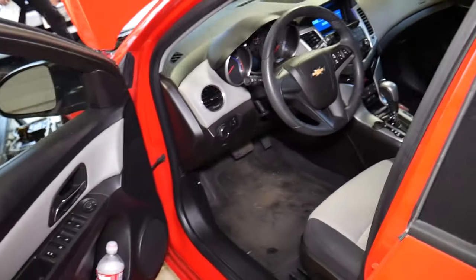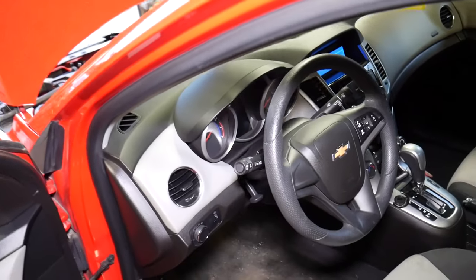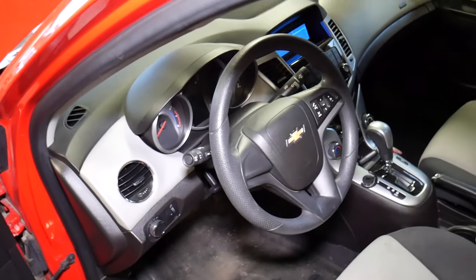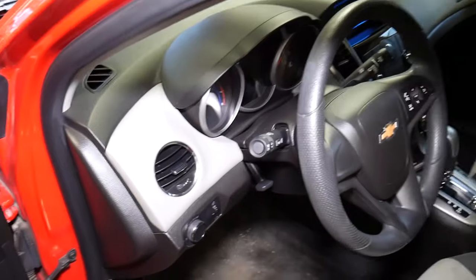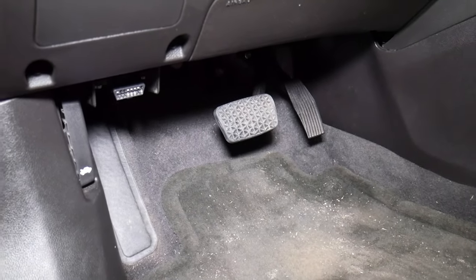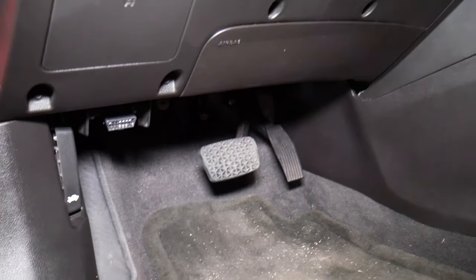If that switch doesn't work, you may notice that your tail lights will not work, and also that your cruise control will not work. You may even get an engine light on — the code for that is P057C, but not always. It could just be a defective switch sometimes. We'll go ahead and position the camera next to the brake pedal and show you what needs to be done.